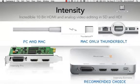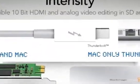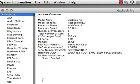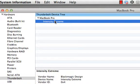...go to the Apple menu on the Mac and do About This Mac. In the More Info area, you'll get a System Report. That System Report will give you a hardware listing, and you'll look for Thunderbolt — it will say supported or not supported. That's an easy way to tell.